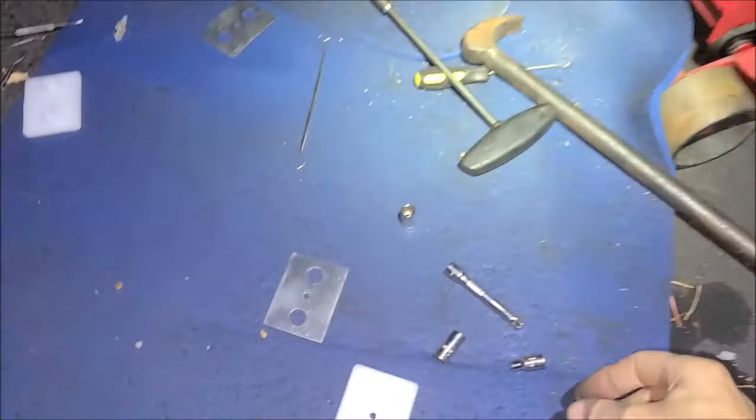So we got done grinding both screws, and now you can run a straight edge nice and smooth. Before it was hanging on those screws really bad. See this other one over here? You just pass right by. If it'll focus, there you go. Yeah, there it is. Goes right over it. Imagine here's a sliding piece. This is what you'll be doing. You need a nice smooth area.